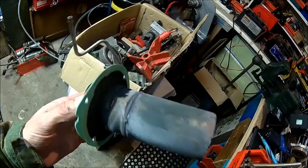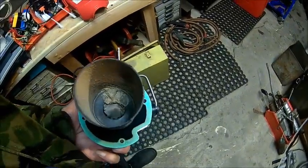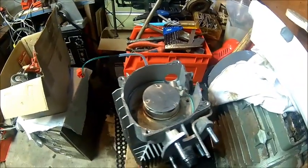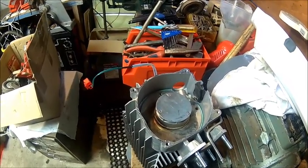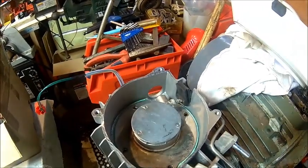It's full of soot at the bottom — a bit dirty because it was smoking like hell. There's some gunk down there, probably because I was burning some rubbish fuel. That needs a bit of a clean, and obviously down here is a bit of gunk as well. I had issues with starting for quite a while, so I always had to start it three or four times before it would work. I did notice the current was getting lower and lower every time I started it, so I was suspecting an issue with the glow plug — and apparently we have one.